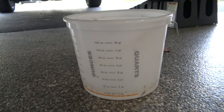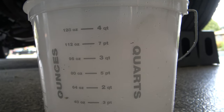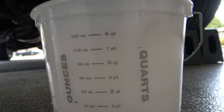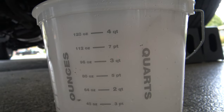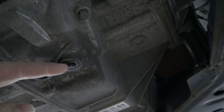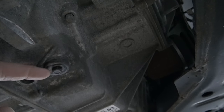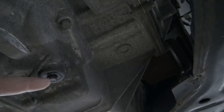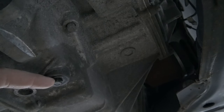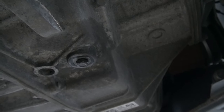Here's my drain bucket — it has graduations on it so it tells me exactly how much fluid comes out of my transmission, because that's exactly how much I want to put back in. Quick tip: before you take out the drain plug, look at where it sits relative to the flatness of the casting. This drain plug is about an eighth of an inch off from being totally tightened. You don't want to tighten this all the way and crack the aluminum housing. Tighten it until there's about an eighth-inch gap. Take a picture with your phone so you put it back exactly the same way it is from the factory.